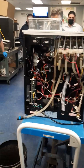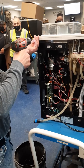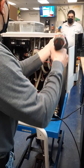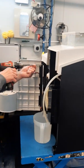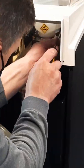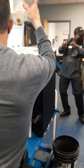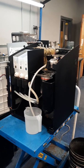If you have a machine that's not getting hot, you need to pop the top to get to the heater. There are four screws in the top of this unit. You also have to remove the bean hopper — it has two screws you just loosen — and the bean hopper should pop right out. Then the top comes off.